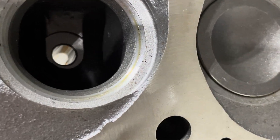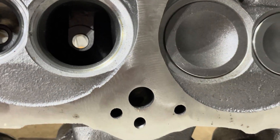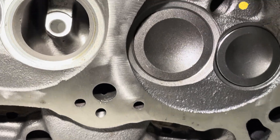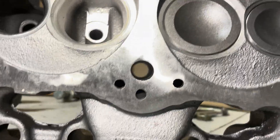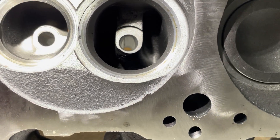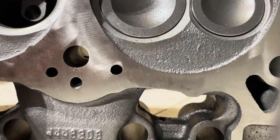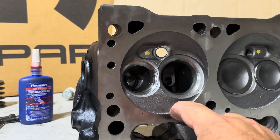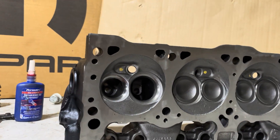There's your valve job — you can see down into the throat a little bit. Let me grab a flashlight and shine it down there. 100% stock. It's an open type of chamber — it's a bit of an open chamber. We got a good 60 thousandths type of recess here and all this wide open area. I don't know how many CCs this is; I will look into that later — I think I still have my CC kit.